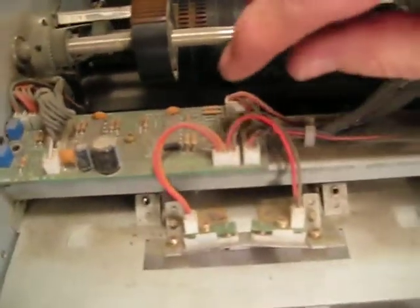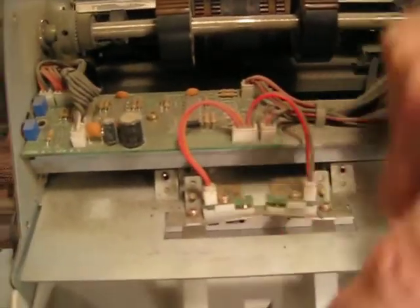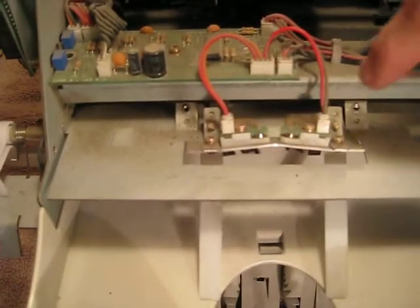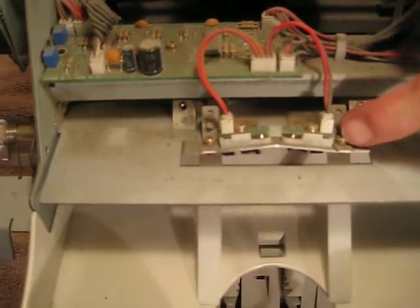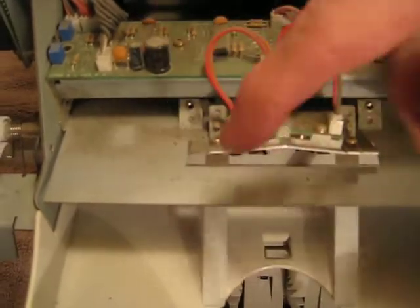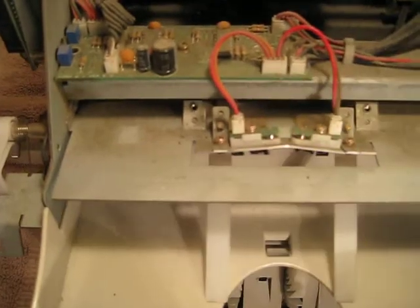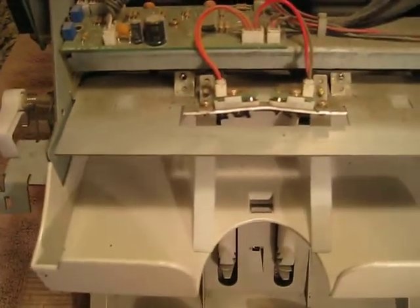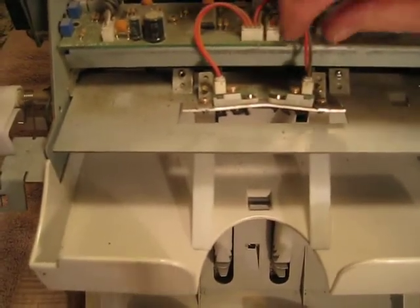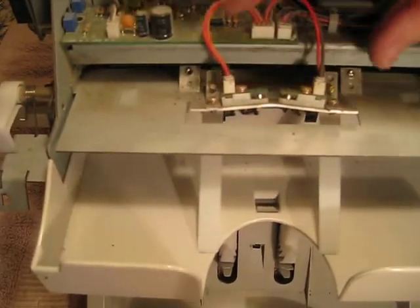This board right here, this is the transmitter and receiver that shines on the mirror for the reject. And you have to basically pull this screw off right here to get the reject bar off. It slides out, put your new reject bar in. It's important that this machine has these things, because otherwise money flies out. Money flying out in the teller's lap is usually never a good thing. So make sure that you have a pair of these reject bars in your box.